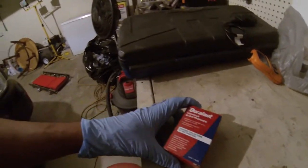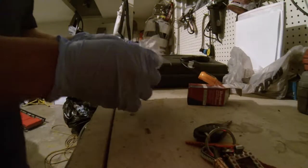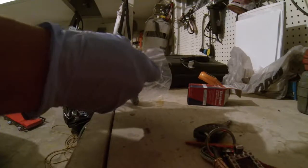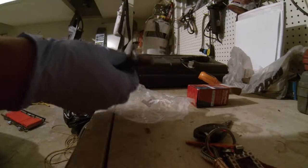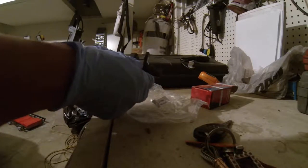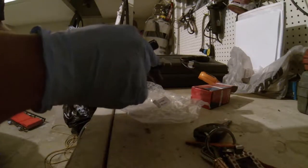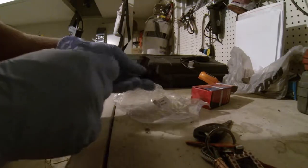So we're going to replace that. I've got my creeper — here's the new crankshaft position sensor. I'm doing this right now because it's late and I use this truck for everything, so I need it up and running ASAP. I've had this truck a few years and this is the first time I've had to replace something. The sensor has three prongs, one bolt — probably 8 or 10mm — so let's find it.